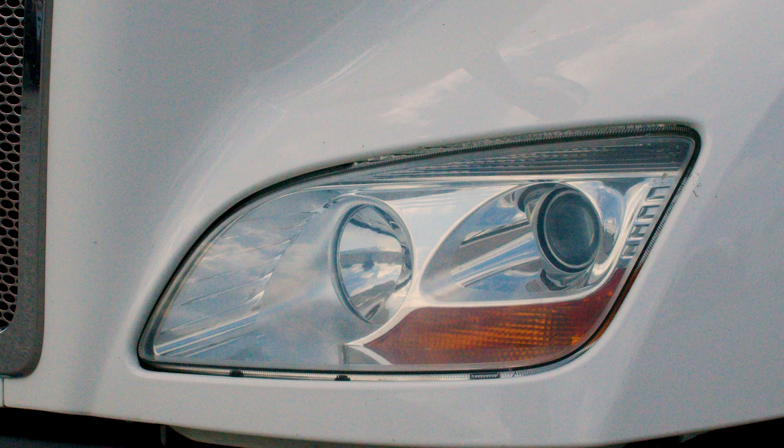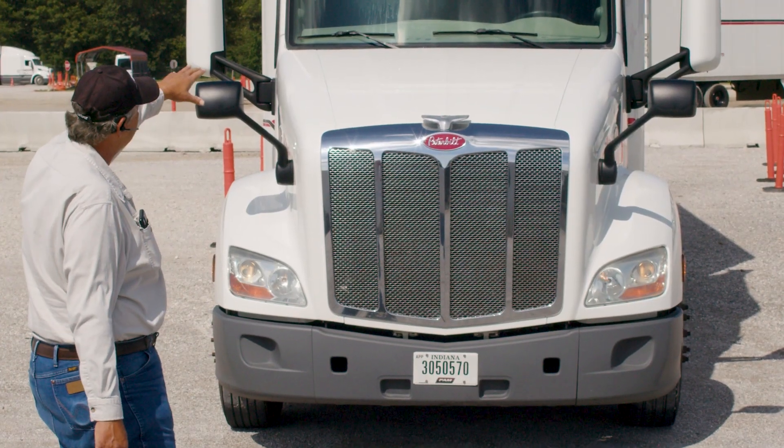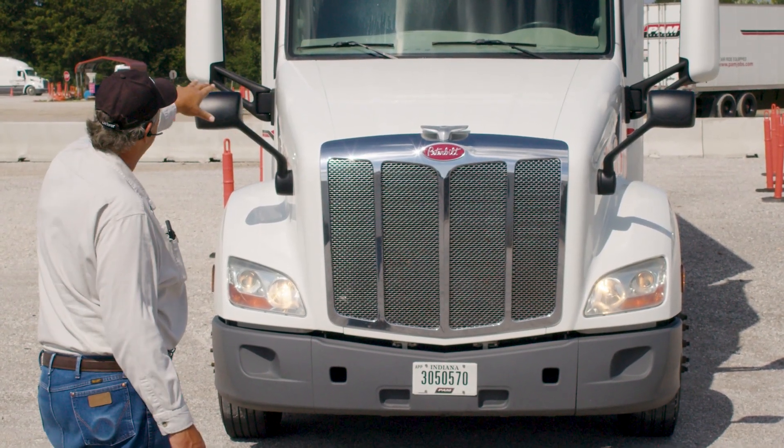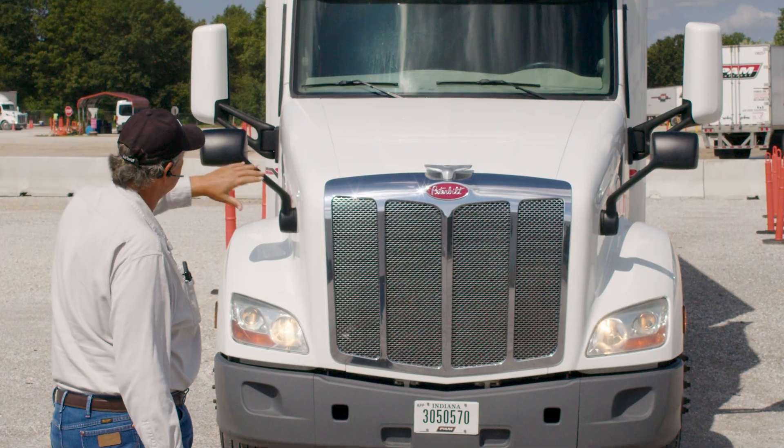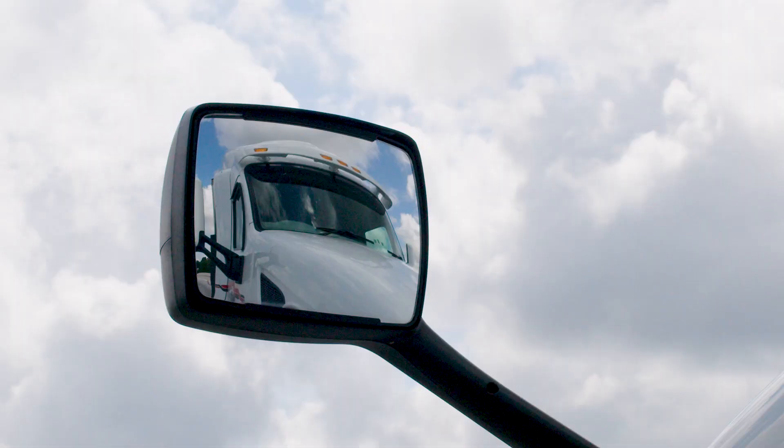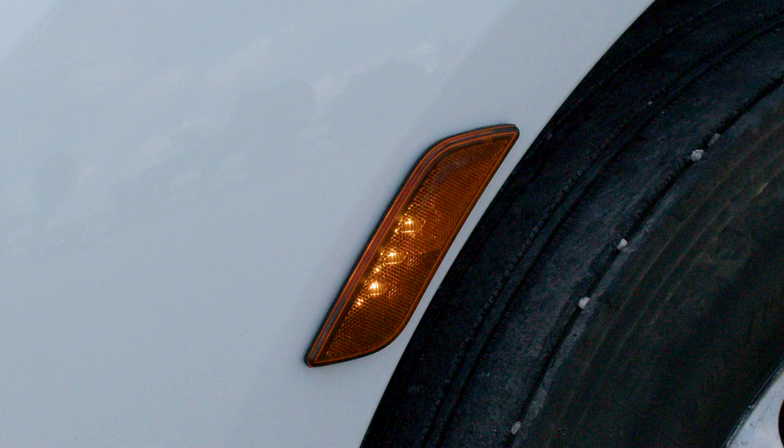You want to look at the front of the truck starting from your headlights. Make sure that your headlights are clear, they're attached properly, there's no cracks in the lenses, and that the headlights are of a clear color and your emergency flashers and turn signals are amber. You also want to look up at the top on your five running lights at the top of the truck. Make sure they're well attached, secure, and of amber. Check your running light on the front corners of your hood to make sure they are of amber color and operating properly.